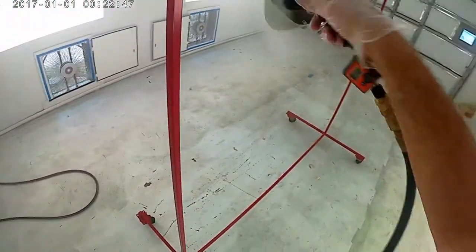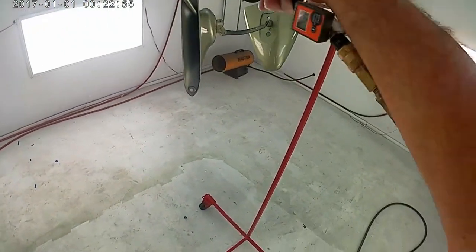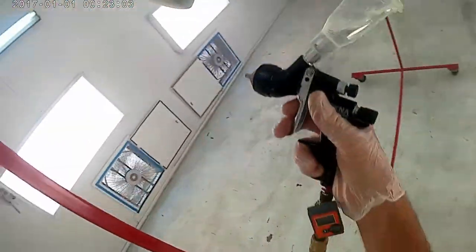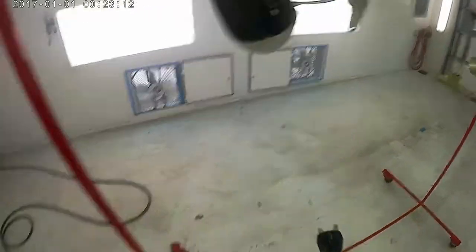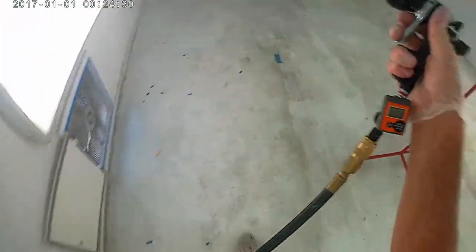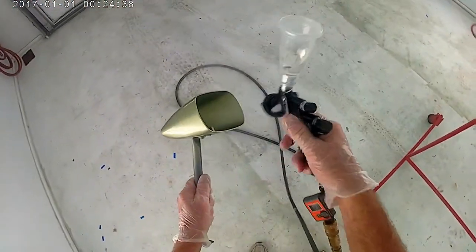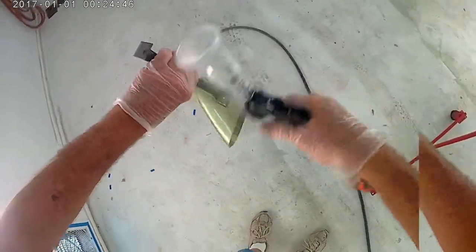The driver's mirror has some remote cables that I wasn't able to take apart, so I had to take apart as much as I could and suspend it in such a way that the parts are separated. One of the bad things about painting something hanging like this is the air turbulence from the spray gun will tend to cause the parts to swing a little bit, which can make it hard to paint. You can minimize that by choking down the gun so it behaves like a minigun, because it requires less air pressure — you're pushing less product through the fluid needle and using a smaller fan pattern.